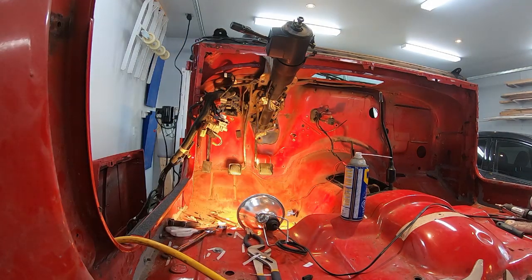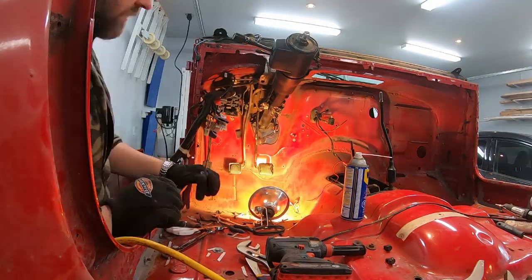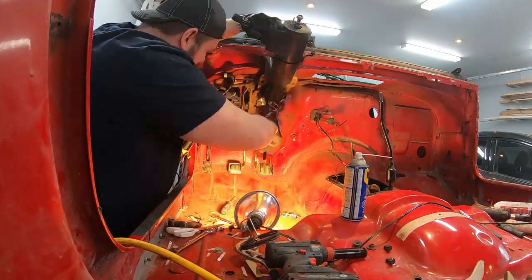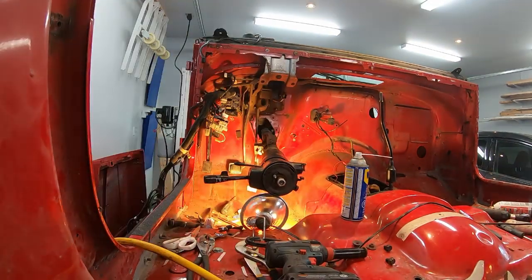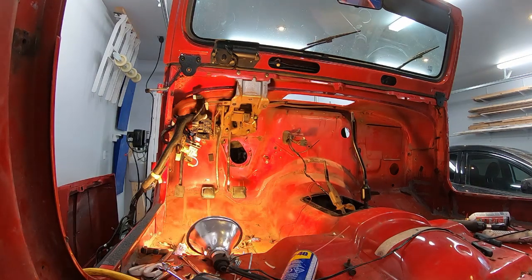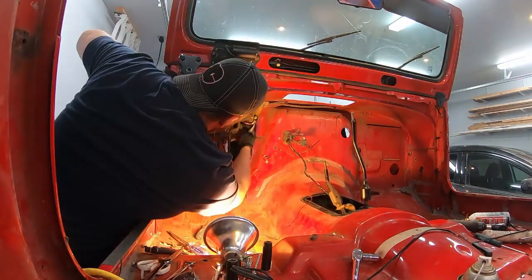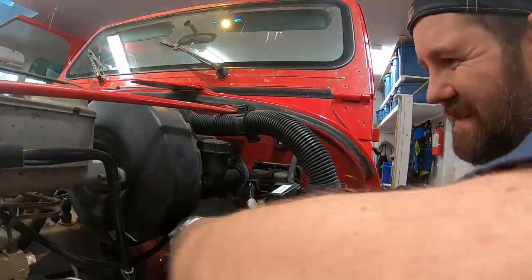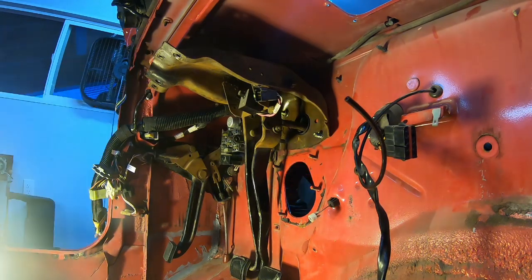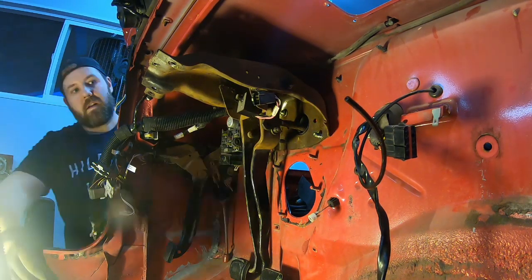Time to tackle the steering column. It's held up to the upper side of the dash with some brackets — I've already removed the lower collar. There are bolts wrapping it that go towards the firewall — those are obvious. Then in the engine bay, take out the one bolt along the top of the knuckle and the whole thing pulls right out quite easily. Taking off what's left of the bracket up top, this part got really difficult because I couldn't get my sockets in there, so I came around the other side and discovered that from the back of the brake system you can loosen them from the back side. Most other bolts are welded right into the firewall, but these are just separate bolts — that's a key thing that will save you a lot of time.